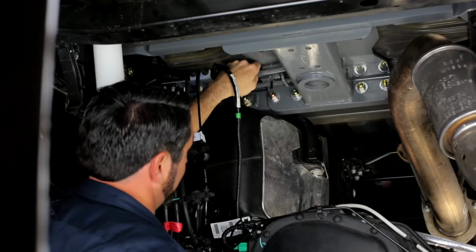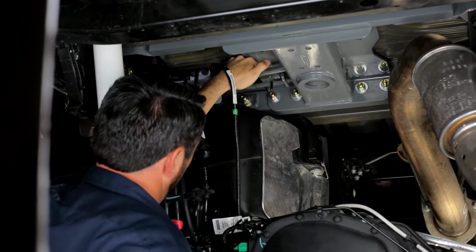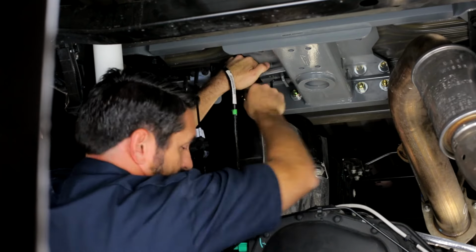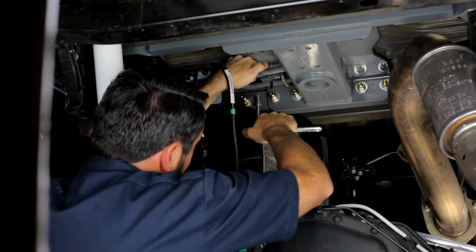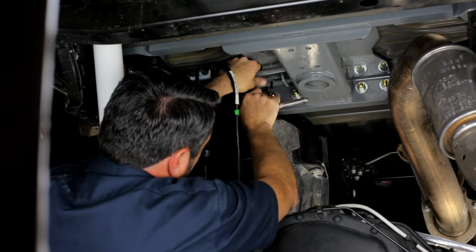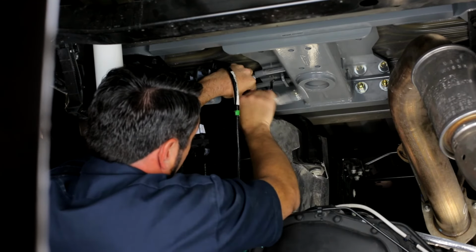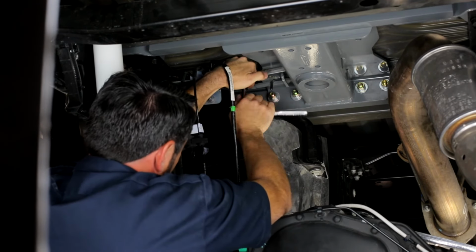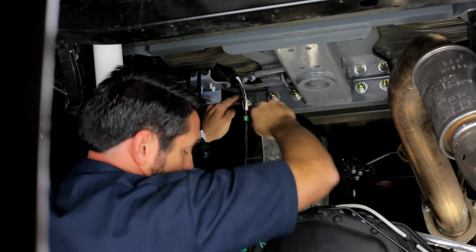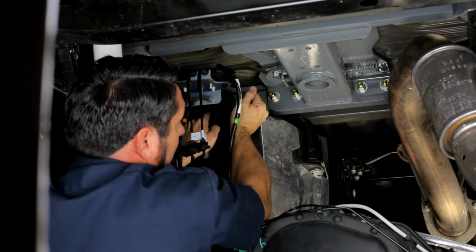Okay, and then take the 2 lock nuts and go ahead and thread those on. You'll only thread on a turn or 2 because they are a lock nut. Now what you want to do is go ahead and tighten these down enough that they're still moving a little bit. Don't tighten them down to where it doesn't allow any movement. Like so. And then take your safety piece, in this case the Allen wrench, out and allow this latch to shut. Don't have your hand in the way.